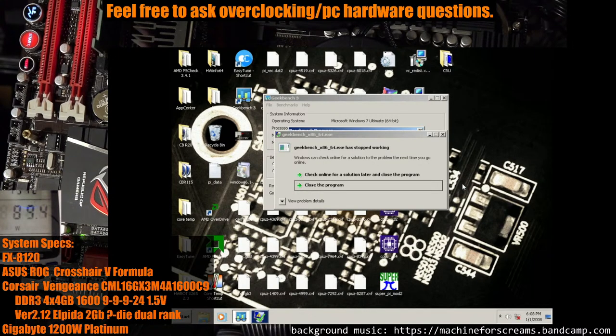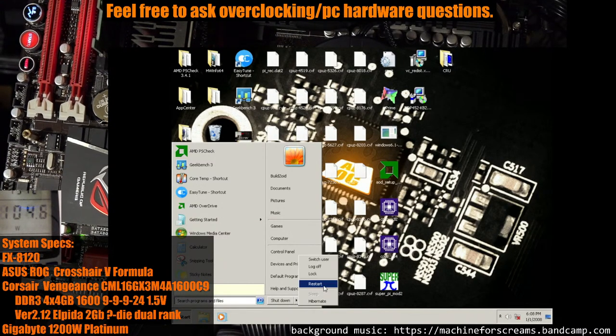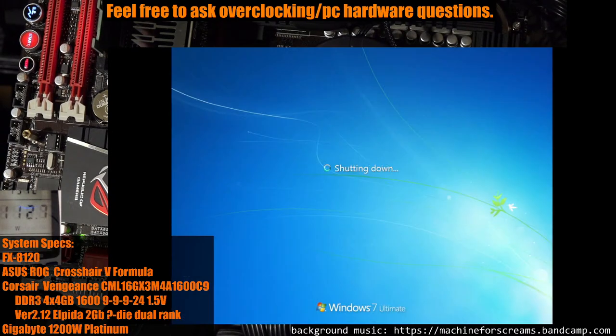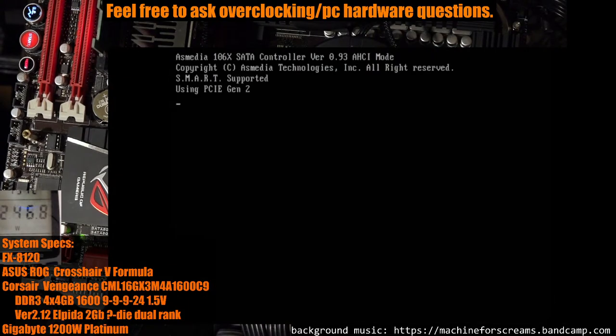You can do like 6000, 30, 32, 32 or something like that at like 1.35 volts. And if you set it to 1.6 volts, it does the exact same timings. Nothing changes. I have a video showing that. Looks like TRP6 won't work unless less voltage helps. I guess it might just be too high.